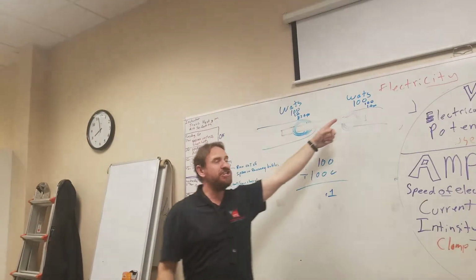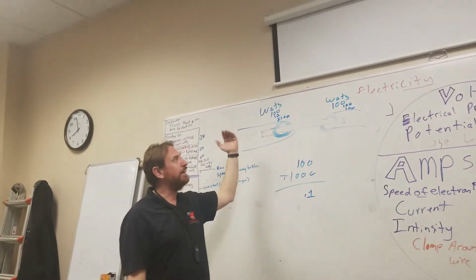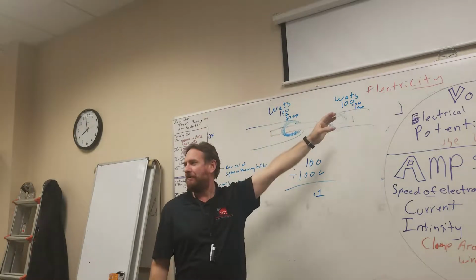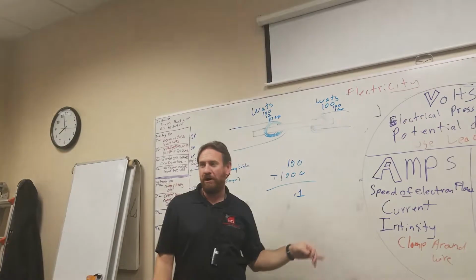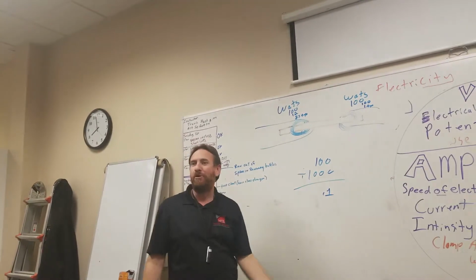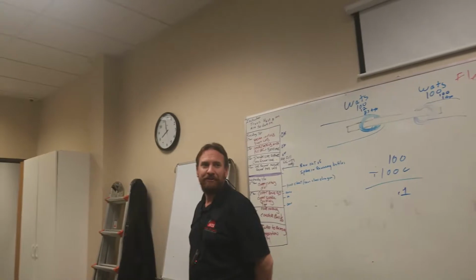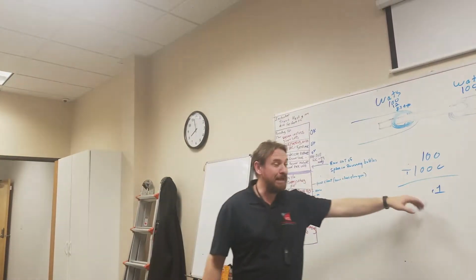Did my watts change? No. I still have my watts. I cannot change my electrical energy. But by pushing it up to a much higher amount of voltage, I end up with much less amperage. So at 0.1, we're most likely not going to kill somebody. But just to make sure, we'll step it up to a higher voltage, which means even fewer amps. It's amps that kill you, right? So I want to get this amps number down as low as possible.